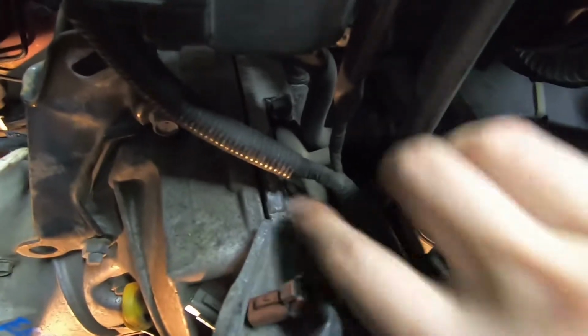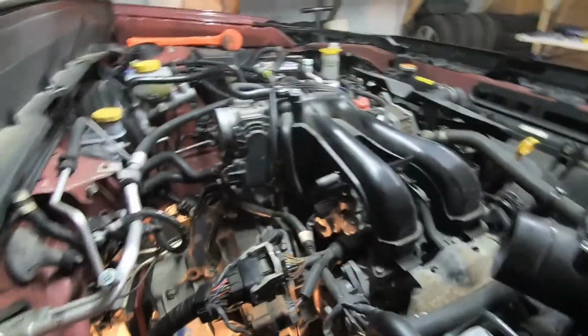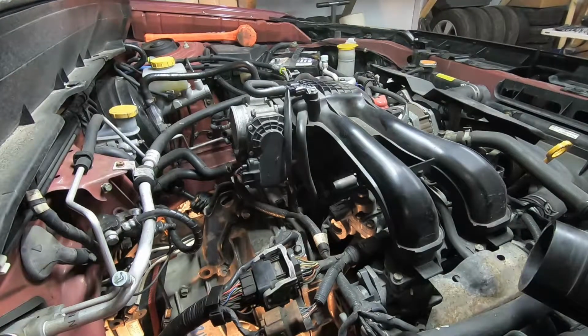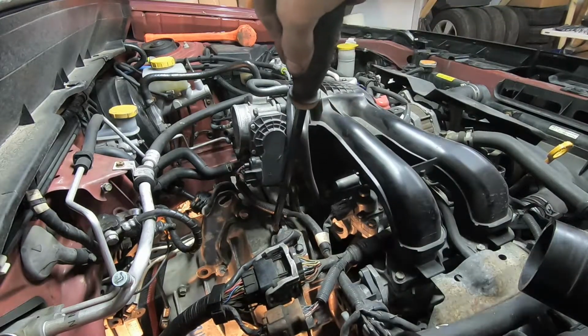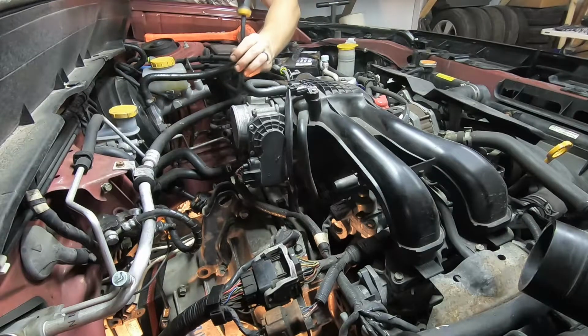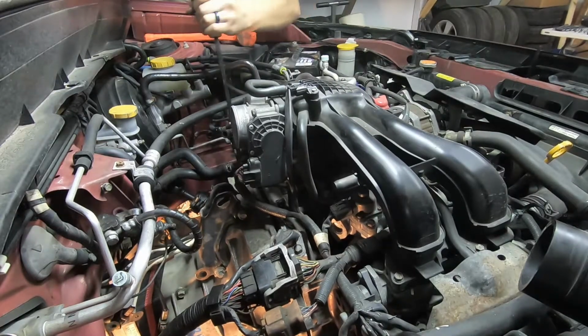If you find that you've gotten a gap here, right here, between your engine block and your bell housing, you want to be gentle here, you want to be careful, because you need to remember that your engine block and your bell housing are both aluminum, but you can utilize a pry bar, again gently, to slide that transmission backwards off. There's 2 dowel pins about halfway up, and then there's those 2 bolt studs at the bottom.